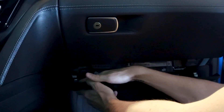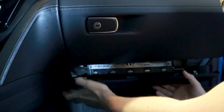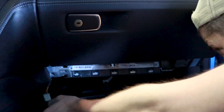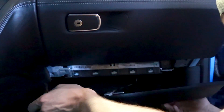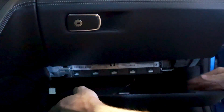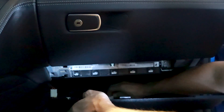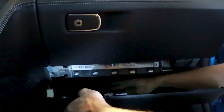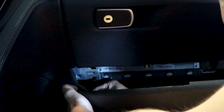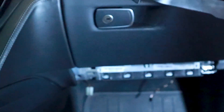Now be careful, because in this corner you have a cigarette lighter or a 12-volt plug — old school. It is connected by wire, so don't just yank straight down on it. Just be careful and kind of pull it out of place. Once you loosen that, this will come down. From here, you can disconnect this wire back here — just pull this little tab out. Very easy to do, pulls right out. Then you can just loosen up your 12-volt plug — that comes right off — and then you can move this piece of plastic out of the way.